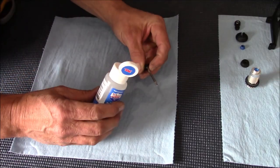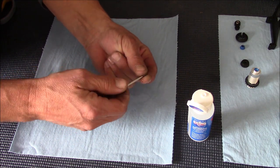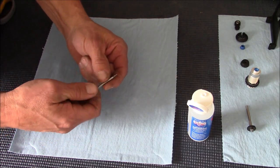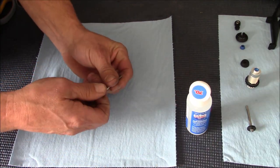What we're going to do is take some shock oil on my finger and run it over the shaft here to lubricate the rod. This is important so that when you stick the rod into the body housing and it goes down through the bottom, the rod is lubricated and it's not going to rip the dry seal or destroy it in any way. Make sure your rod is lubed before you put it into the dry seal. Just a little bit of lubrication on your finger - it doesn't take very much - and go ahead and lubricate the rod thoroughly. Do this for all of the rods.